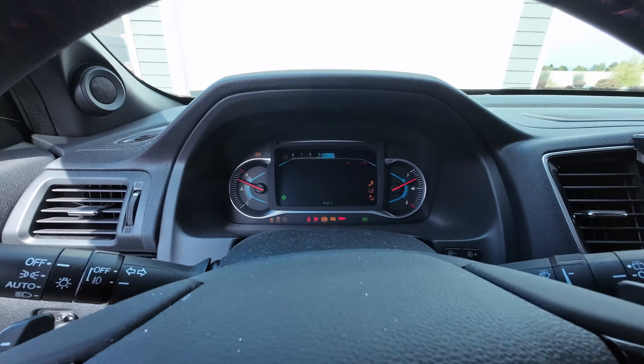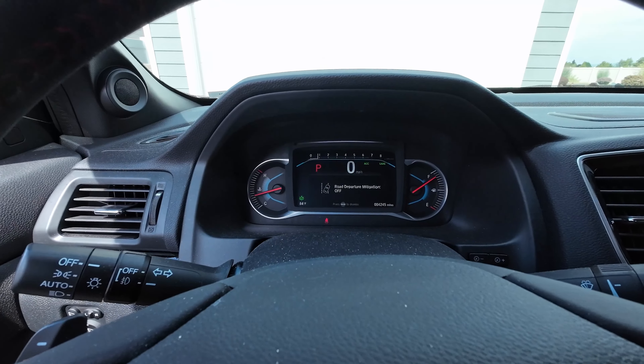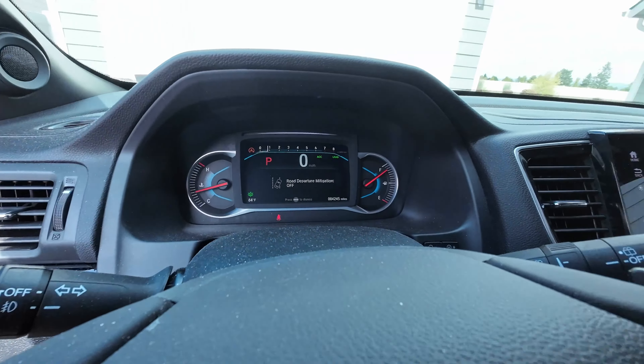With all of our stuff plugged back in, the first thing we need to do is start it up and see if the indicator for the start-stop turns on on the dash. It should take a couple of seconds — let's fire it up. You can see it up in the left corner briefly and it should pop back on now once it runs through all its checks. And there it is right there. Now every time we get in the vehicle, the start-stop will be disabled. And if we want to use it, awesome, we can push the button. That would have been a great feature for them to have programmed into the car — maybe a little on/off you get to choose instead of them choosing for you. But in this case, the idle stopper — you plug that in, took us all of what, like five minutes? And now we have the feature the way that we want it. Hope you enjoyed watching this fun little outtake here on my buddy's Honda Pilot. Look forward to seeing you in the next video.